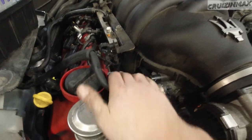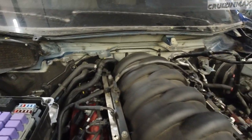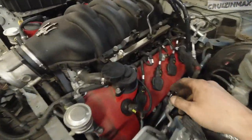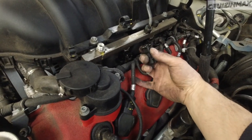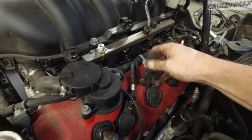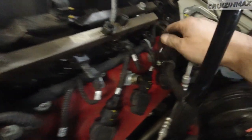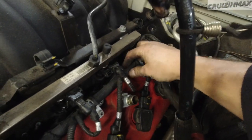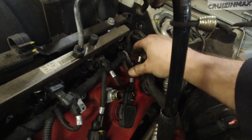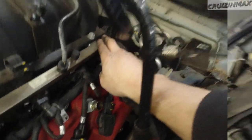The intake should come up with the fuel rails and injectors because these are port injectors, so it's all together. Next, for the fuel injector connectors: with a flat screwdriver push this tab up. If it pops up, put it back in — that's how they work, they will go back in. The only thing I had trouble with was this clamp right here that holds the harness — it was all the way to the right. I just loosened up this allen bolt and moved it back so I had access to the spring on the fuel injector.